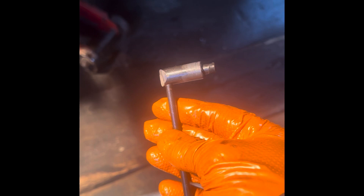So now what we'll do is take the locking pin out from the flywheel, take that locking pin out, and then I can turn the engine over and get to the con rod big end. That's out. So now I should be able to turn this.